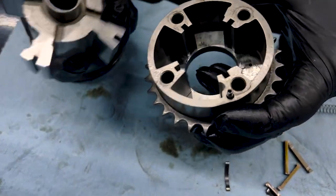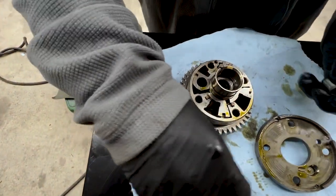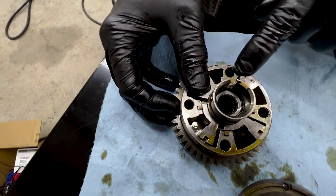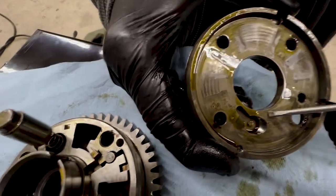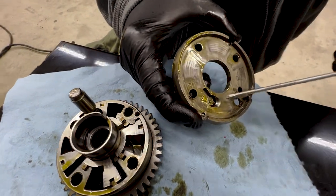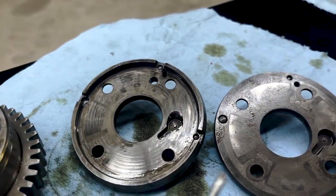Three weeks later, with a little fiddling, when we're right here at this pin, that's where we've got to get the pressure off — there she goes. We've got our exact same internals, we've got our locking pin here. It looks a little different — I don't remember this piece in the other one; maybe that's a revision. Look at the damage. Look at the damage. Here it is — this is where the pin locks in, and it is just completely eaten away. It's gone. This cam phaser never had a chance. Obviously, this is the mechanism that moves back and forth inside the cam phaser, but the locking pin is the issue.